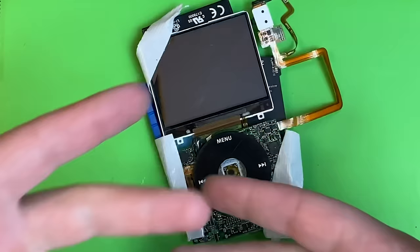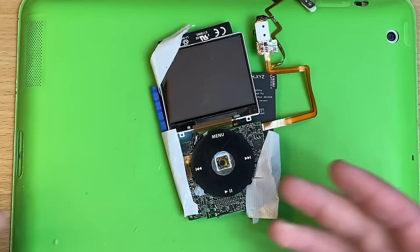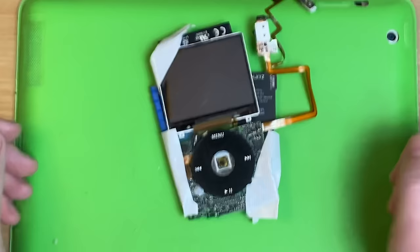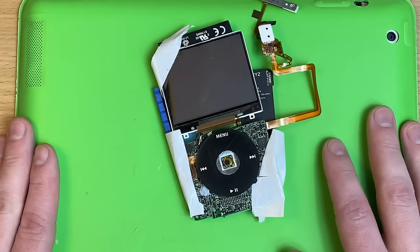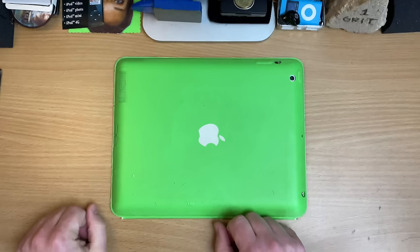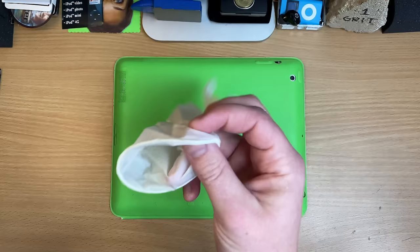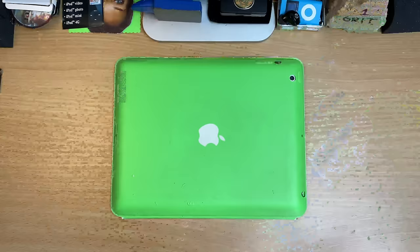In this video, I'm going to be tearing all these iPods down to their chassis rails, right down to the motherboards. You just get up to the point that needs fixing, replace the part, and backtrack the other way. With all of these iPods, the main culprits are batteries and hard drives. After that it's displays, then maybe the touch wheels, then the headphone assemblies. Beyond that you're in no man's land chasing very small problems, because these are vintage now and new problems are coming up all the time.